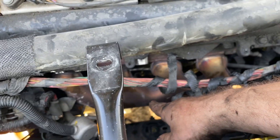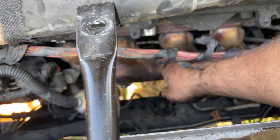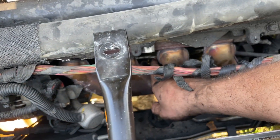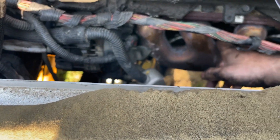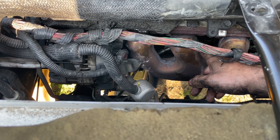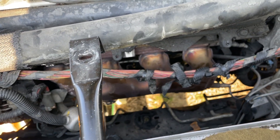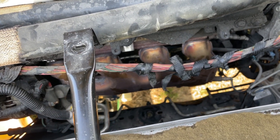So we're at our main event - which is what we're here for. Our switch is right where my finger is pointing. We got to disconnect the electrical connector - it's just your basic lift up and pull. We have to get that out of the housing, then get the housing off the engine. It's held in by three 12-millimeter bolts. We got to get our sending unit out from underneath, so I'll get that all torn apart and bring it back to show you.